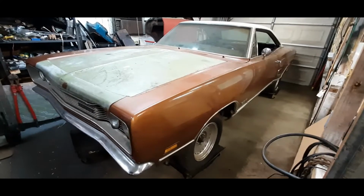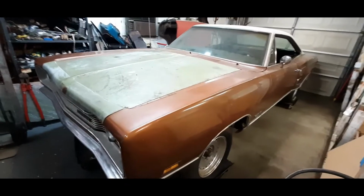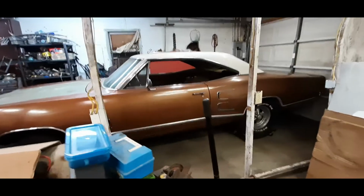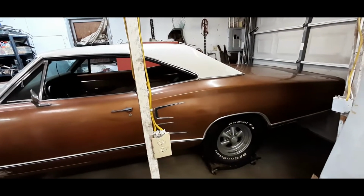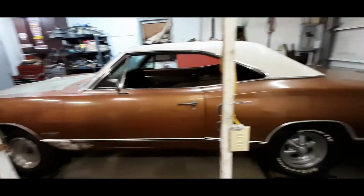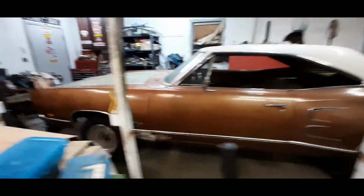I put a 391 8 3/4 rear in it for a while. We stuffed in a 440, an automatic out of a '76 or '77 Chrysler New Yorker that I bought for $150, and drove around for a few years like that. Put the Dana in somewhere along the line, I forget when. The motor ran fine, but not much for oil pressure. The rod bearings were completely copper when we finally took it apart. So, you know, we did the right thing and just ran 85W-140 gear oil to keep that pressure up. Worked pretty good.